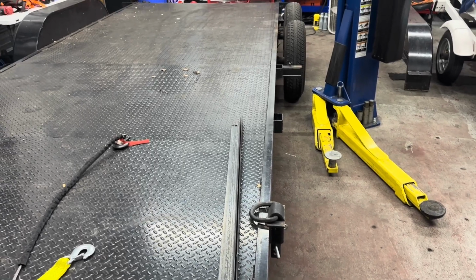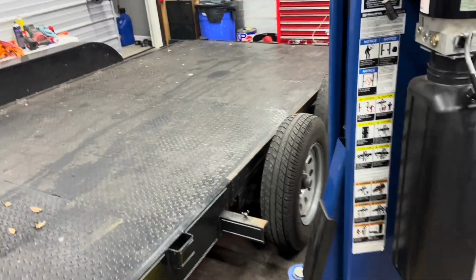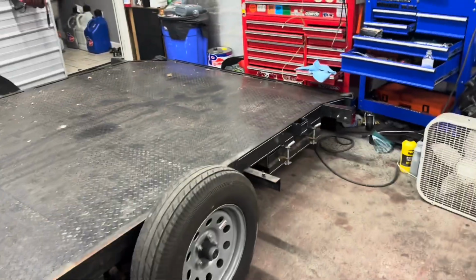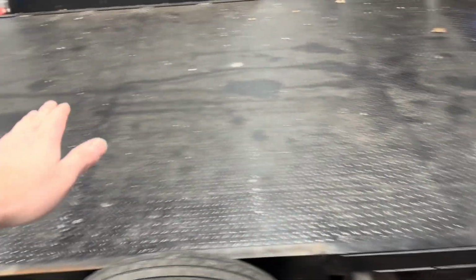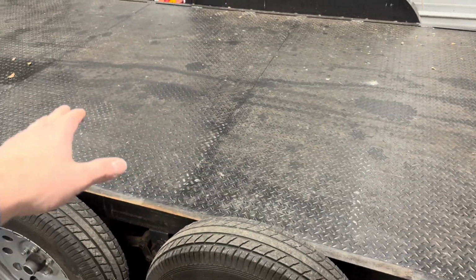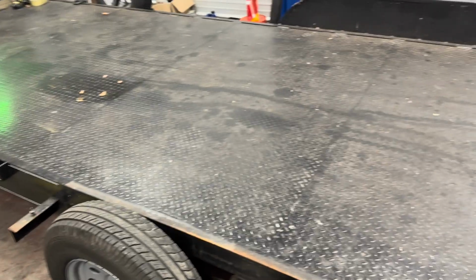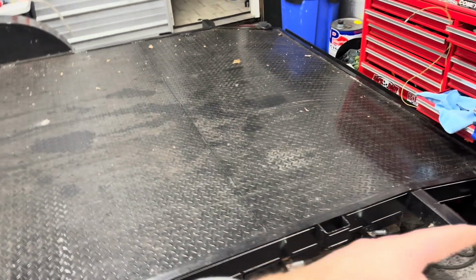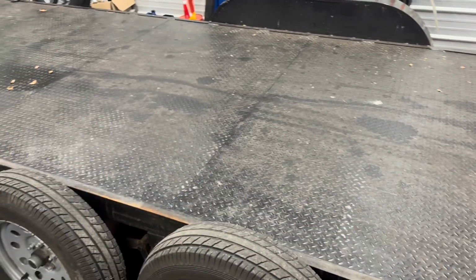What I ended up actually doing, I love having to make up scenarios when something happens, right? This car sat kind of high. It was an old Plymouth. We took the ramps out, put the ramps underneath the front tires upside down so it would slide, and then pulled the front wheels up on the ramps. And then as the car would come up, we would push it over, and it would slide because the ramps were slick on this floor. And then we just pulled the back end up. And that winch was able to pull this car sliding on the ramps and pull the back tires over the back of it with no ramps on it without any issues.